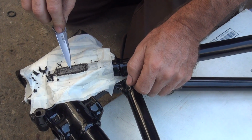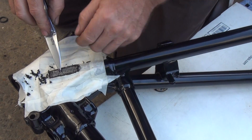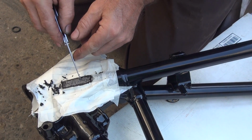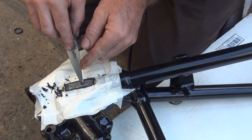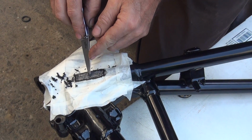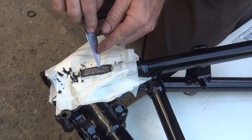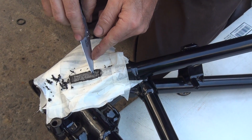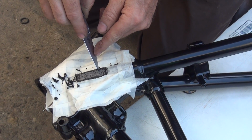You can only stamp a number once. If you don't stamp it all the way through, you gotta leave it. Can't double stamp it or they'll call it double stamping, and it's an illegal number. When you stamp it, you gotta stamp it one time and hard. And if you don't get the whole number, you just leave it and go on.